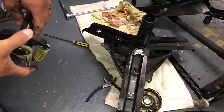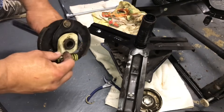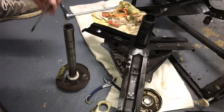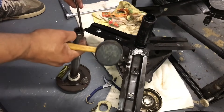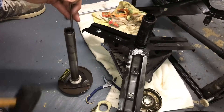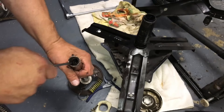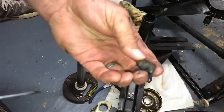To remove the upper shaft seal, I'd recommend taking this ring off and taking this plastic piece off because you don't want to break that. Stand this up on end, get a screwdriver down along the edge of that — between the shaft and the old seal — and hammer it like that. You'll see it curl over, and then you should be able to get in there and work the old one out. There it is — there's the old seal.